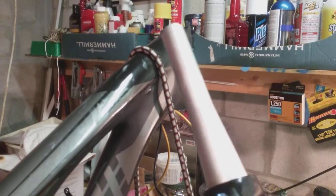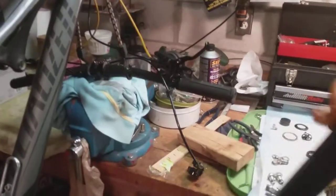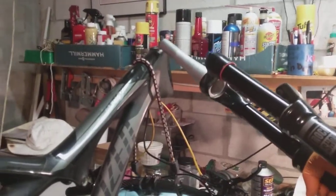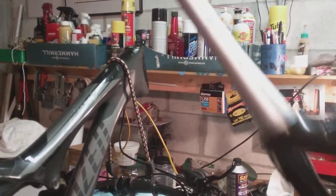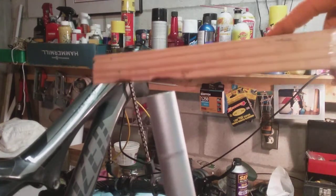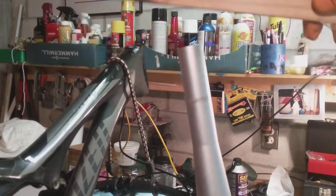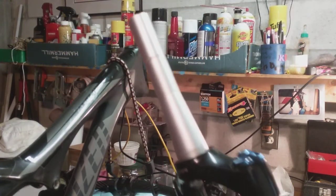I disassembled it first in terms of nuts and bolts, then tapped it and got about a quarter inch of slack. I was then able to put the bottom of the forks up on the workbench to take some weight off and get the fork pushing up into the frame. I got some slack up where I'm pointing, and then I was able to tap with a little wooden block on the bearing that was stuck inside the bike — tapping around the bearing and knocked it off.